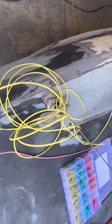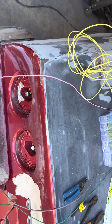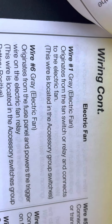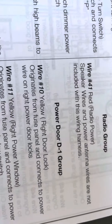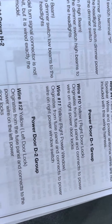You'll want to make sure wires that go through your firewall use a grommet — don't use it without the grommet, it could short out and burn your project car right down to the ground. The important ones to me obviously were the lights, horn — things that in some states with inspection stickers you'd absolutely want to work. Electric fan — I don't have one, I might add a pusher fan if I can fit it with my hood. You can use those wires for other things — it's a nice hot wire for hot-wiring anything else.